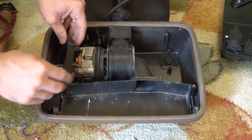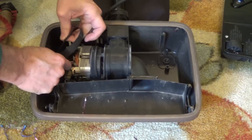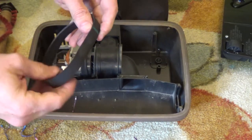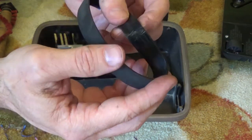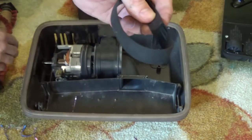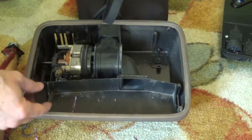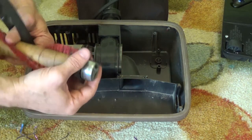Before I put this back in, I'm going to examine this belt a little closer. You just wiggle the belt out here. Usually there's a little more space to get the belt out — there we go. You can see it's not really in the best shape. Look at that — very much cracked up. That's the damage that's happened as a result of that spinning. It pretty much burnt here since the belt couldn't spin — it basically burnt this part of the belt, and that's the problem with a lot of the string. So yes, I will have to replace this belt. But first I'm going to put this back in and see if I can get it working again, since it's moving a lot freer now.